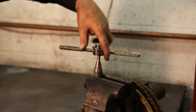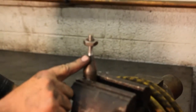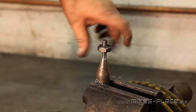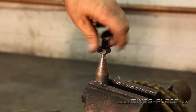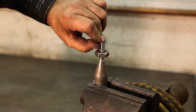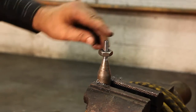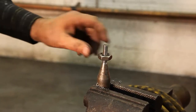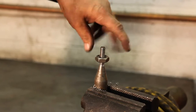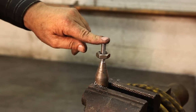So now we've cut it all the way down. You can see we've cut our threads all the way down to the vise, so we can actually put the knob on and take the knob down probably an inch. Now before we cut this shaft, we want to leave the die on it — we'll take about an inch off of it, and then we'll have that much thread left to put our knob on. So that's the poor man's short shifter: cut it, leave the die on, take the die off after you do your cut. That'll leave you a fresh, clean thread to thread your knob back on. You might want to clean it up with a file also.